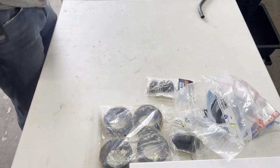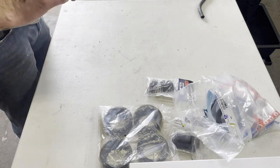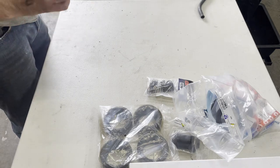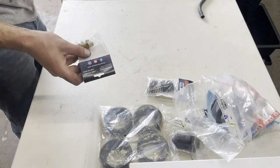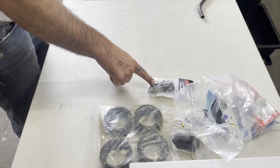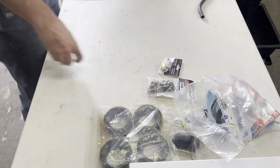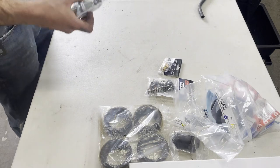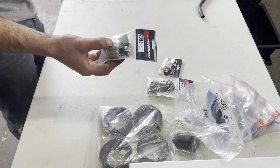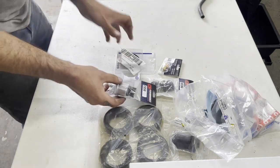I have a, this is for temperature, as I recall, oil relief plug, oil temp sensor. I'm moving the oil temp sensor sending unit to one of the threaded plugs for the relief so that I get a more accurate reading. And then up the top where I put that adapter I didn't have to buy, I'm putting a sending unit for the oil pressure sender because I'm adding an oil pressure gauge.